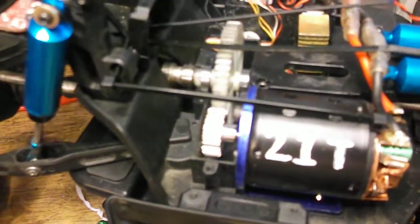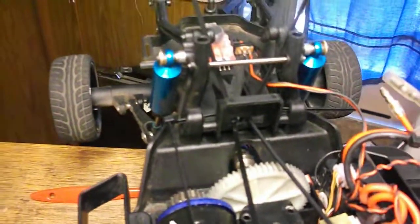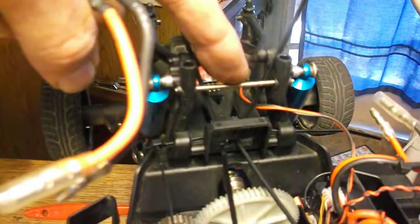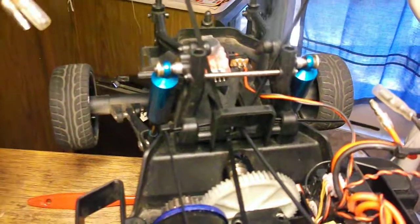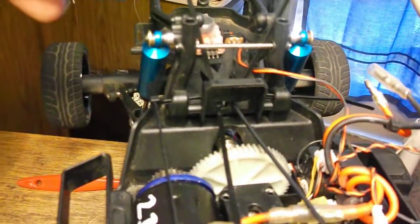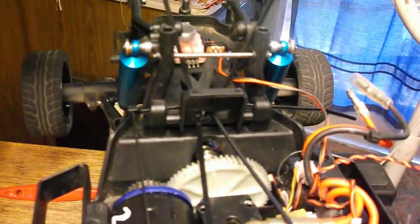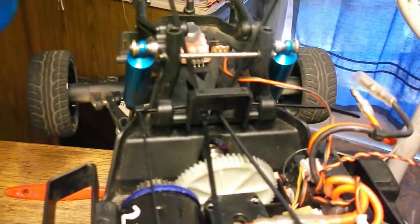And I'm just kind of panning around the car here. I thought I'd show you, before I take them off, how I mount the stock battery in front of the shock tower. And here's my all-thread shock tower brace. Couldn't be simpler. The hole's already there. 2mm or 3, I think it was a 2mm rod, or 3, I can't remember. Anyway, they're $1 each, buy one of each. Makes a perfect brace for the shock tower. You just thread it through, you're done.